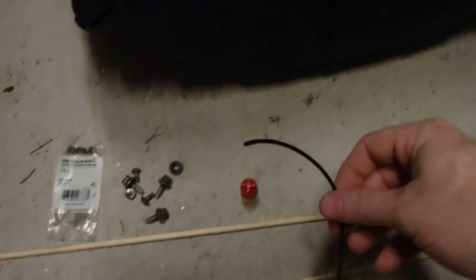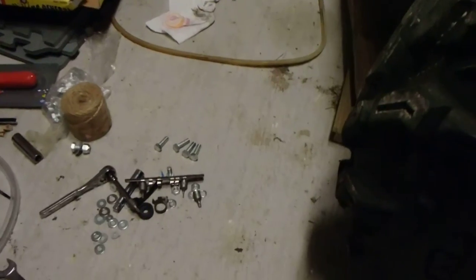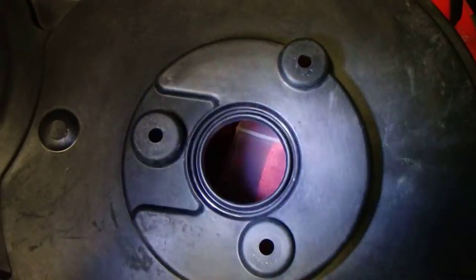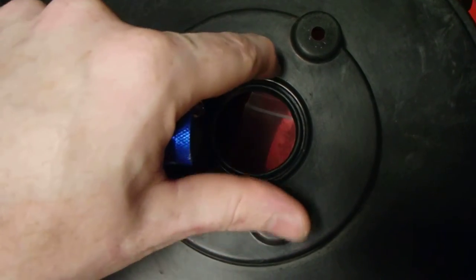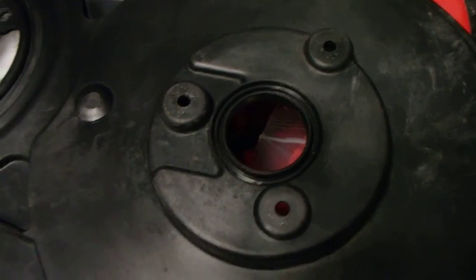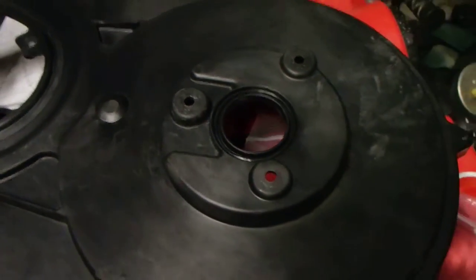So what I've done is I've taken a few spare O-rings I had laying around, cut out a section, used some super glue, and made myself an O-ring. If you can see this clearly, the O-ring is riding on the outer edge of this inner lip — fitting as tight as it can against the outer edge without being stretched or pressed in any way. When I line this up with that blue seal, it fits perfect up against there. I don't want to put blue RTV or the Right Stuff or any other sealant in here because I'll never get it off.